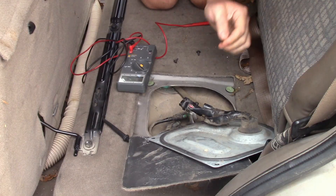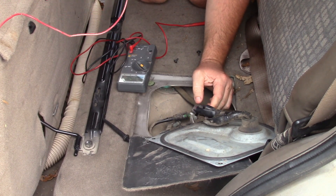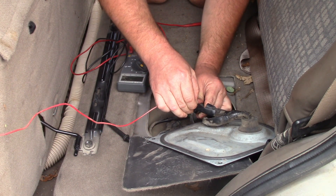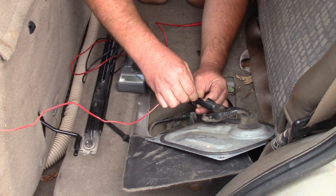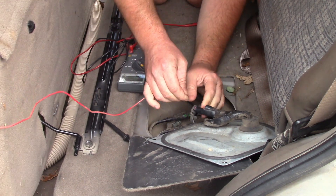I'll move my plug down to where there's constant power — the ignition is still off but we've got constant power from this bottom pin. I'll go ahead and plug this back in. We have constant power to it now. Does anything happen? I'm not hearing anything. I'm not sure I'm getting a real good connection, but we might be looking at a fuel pump issue. I don't understand why the voltage drops so much.